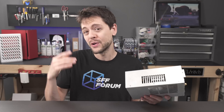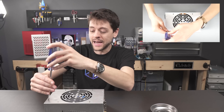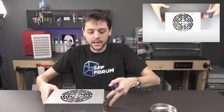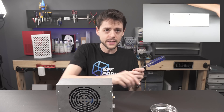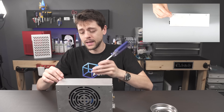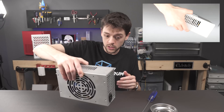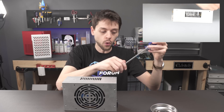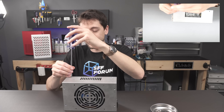Of course you can check out that thread, but what you're watching this video for is to see me open up this masterpiece. Because this is a built-to-manufacture design, getting inside should not be difficult at all. Just as a side note: I'm using a number two Phillips head screwdriver — about five millimeters or a quarter inch shaft. This is what I recommend for taking apart an S4 Mini. If you use an iFixit kit, it's great, but it won't give you the torque or down pressure needed to avoid stripping screws.